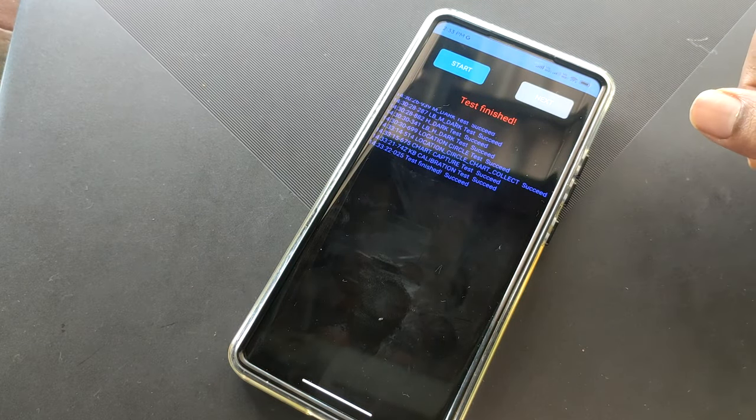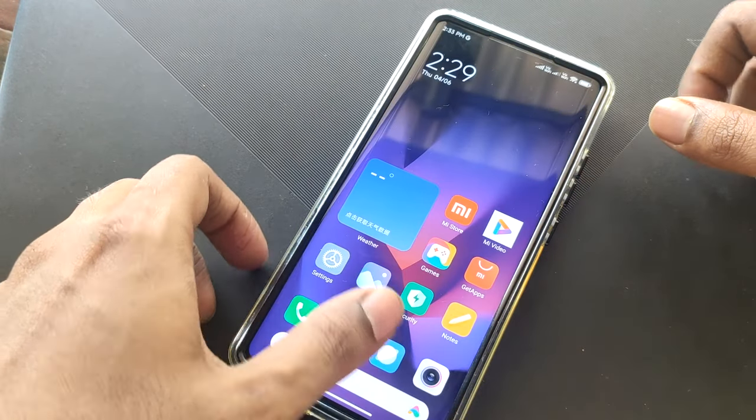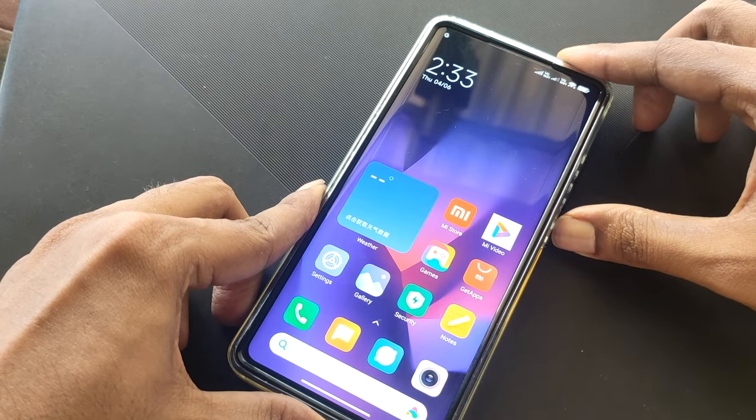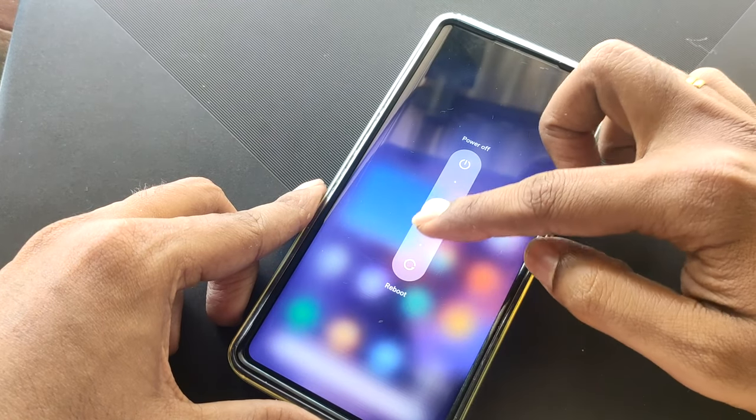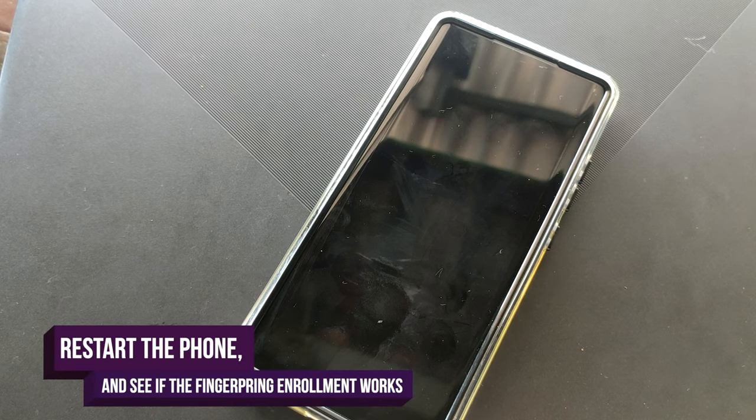The calibration is completed — you can restart your phone. This is how you calibrate your fingerprint sensor on Xiaomi devices without using the separate fingerprint calibration tool. They normally use a separate tool which has all the textures on it, but I was unable to find it after I replaced my screen, so I found this method to be working.